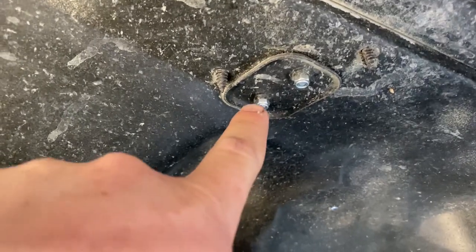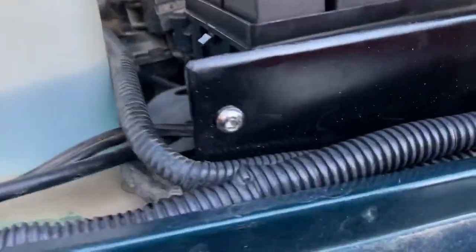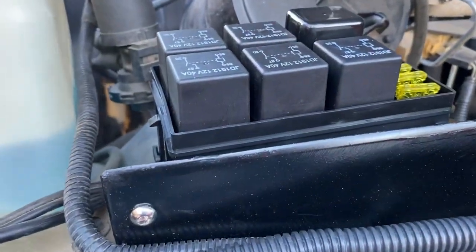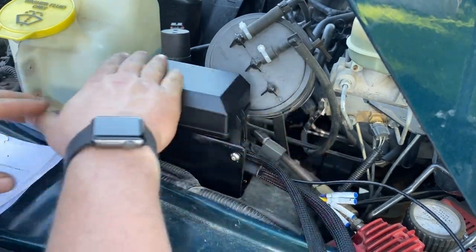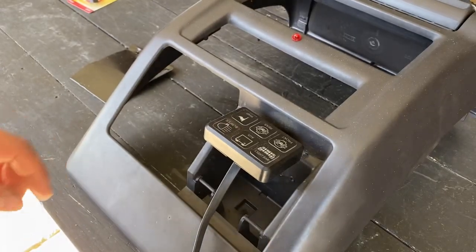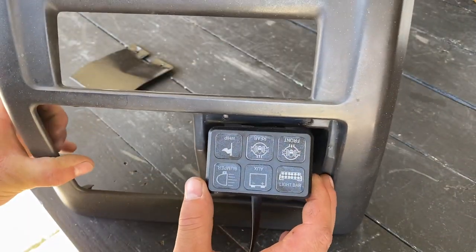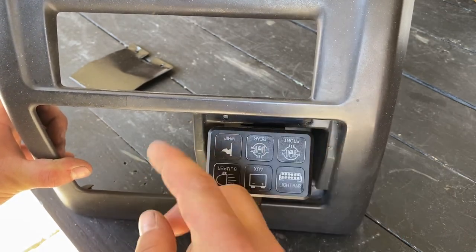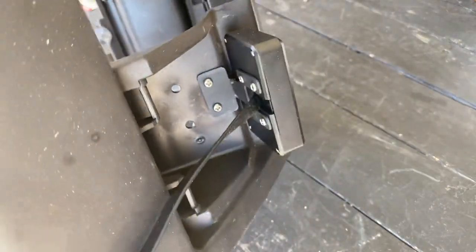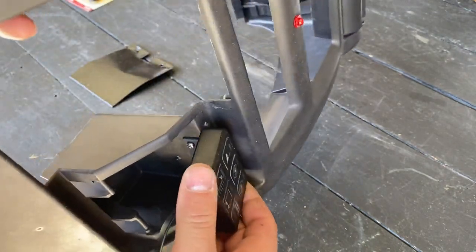Underneath the fender of the Jeep, they had these holes right here and I just used those since they weren't being used. There's a steel bracket underneath here which kind of helps give it more integrity. That's where I'm going to bolt up this bracket here for the distribution box. I'm going to take the supplied screws and mount that came in the kit and install it on the dash for the Jeep. I found the best spot for it and it's going to go right here. I actually put my stickers on upside down so I've got to fix that. That little bracket worked out perfect — I took my drill bit, made some pilot holes, took some screws, and it's actually a really solid mount.